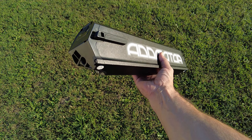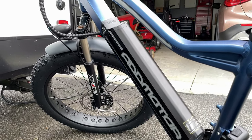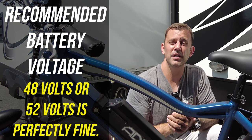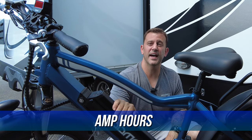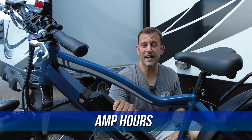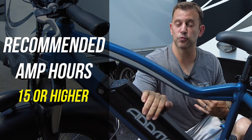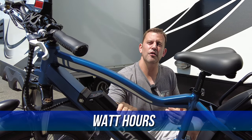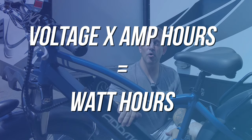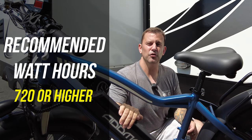The most common battery sizes are 48 volt and 52 volt. The 36 volt batteries have kind of fallen out of favor, since they just can't compete with the 48 and 52 volt batteries coming standard on most bikes today. If you have a choice, go with the 52 volt battery, but if the bike you really want has a 48 volt battery, it's still a great sized battery. Amp hours give you a good idea of how long your battery will last on one charge — think of it like a gas tank. The industry standard is around 10 amp hours; 15 amp hours is really good, and anything above that, like 17.5 or 20 amps, is great. Watt hours tell you how far you'll be able to travel on one charge, determined by multiplying the voltage by the amp hours. The low end is around 480 watt hours, while the upper end is around 1,000 watt hours.